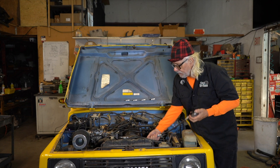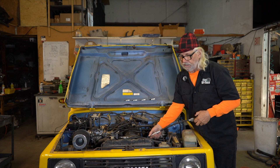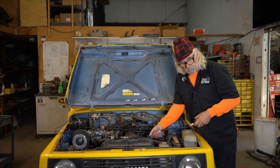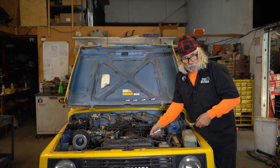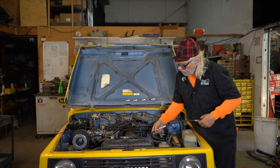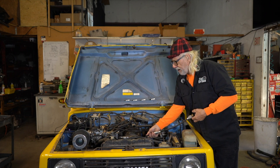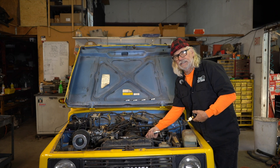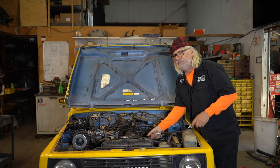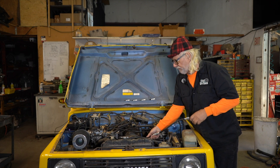I'm going to write the number down on the firewall — that's my technique. If you were out buying a car and you had 155 pounds of compression, the seller could say it drives really fast, 65 on the highway. Sure, but that's not peak for that engine and it will have to be rebuilt. So knowing the compression can help you when you're selling or buying as far as the price goes. I never buy a Samurai for sale unless I do a compression test, and neither should you. Always know what the compression of the engine is — it's the most expensive thing to fix.